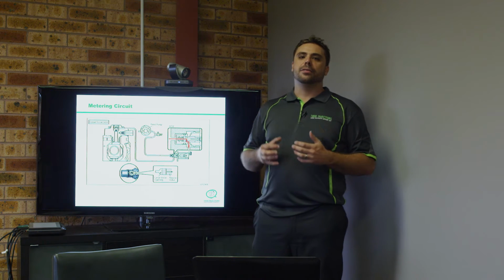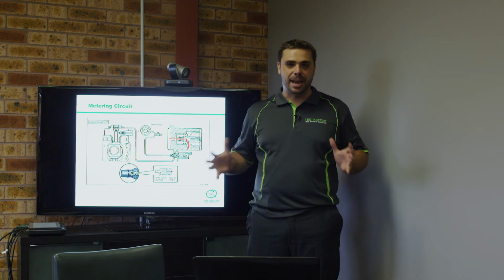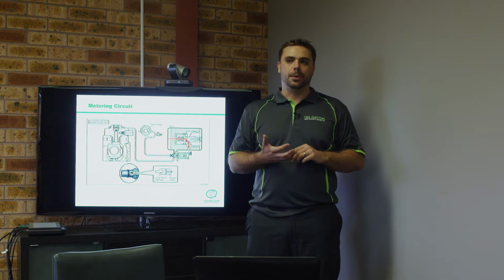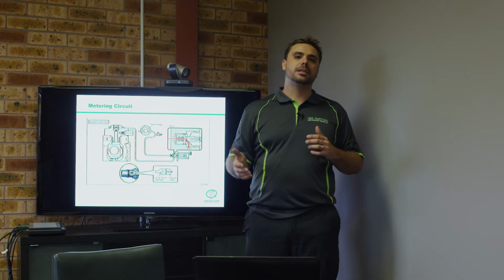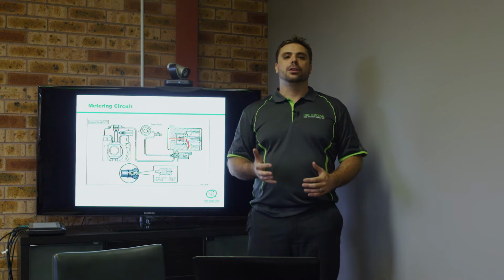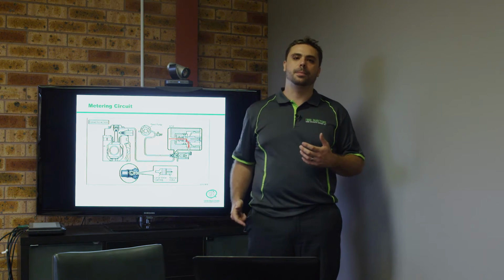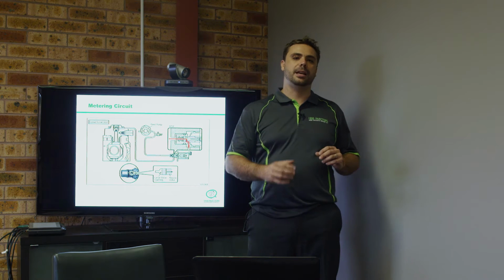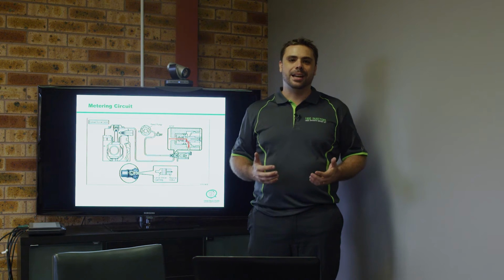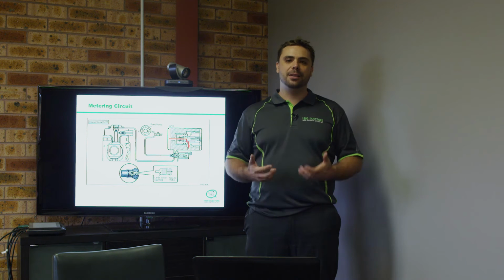A suction control valve is a massively important piece of equipment when we talk about the common rail system at large. If you think about it this way, if we run, say, a V8 fuel pump at 100% load, which is 1600 bar, and you were to think about a common rail pump the way you would look at a petrol pump that feeds 100% all the time, with that little electric pump in the tank that flows 100% and we just return to tank what we don't use. But in common rail, we're talking 1600 bar, 1800 bar, 2100 bar in some of the new stuff, by a significant volume of fuel.